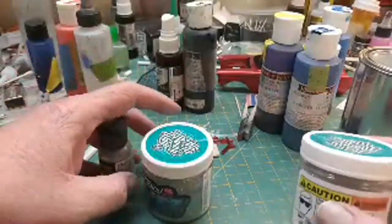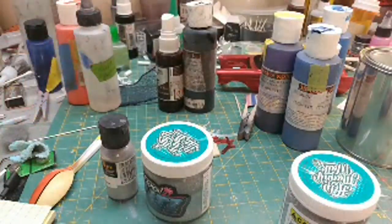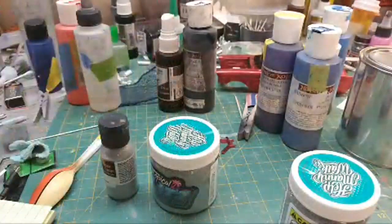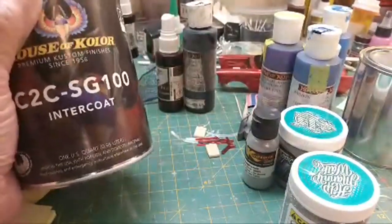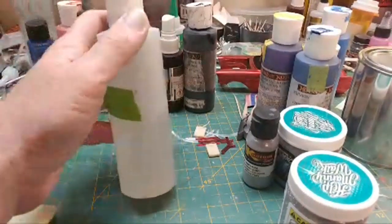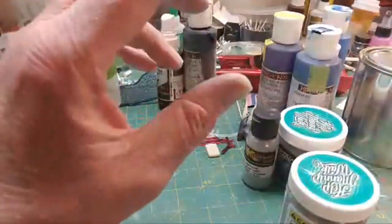I have a Flake King. Once I spray the Orion Silver, I put down the intercoat clear, which is your intercoat clear mixing stuff. You mix this 1 to 1, and I always keep a bottle of it pre-mixed like this. With the Flake King, you shoot this, and then bust the Flake King on top of it. You just shoot it, and it lays nice and level.